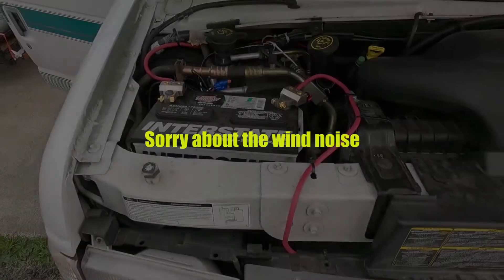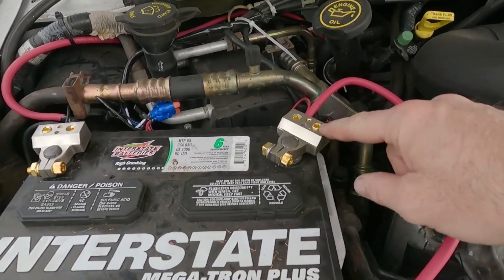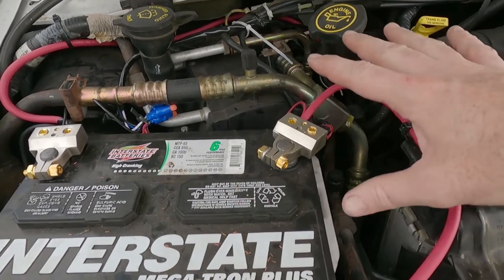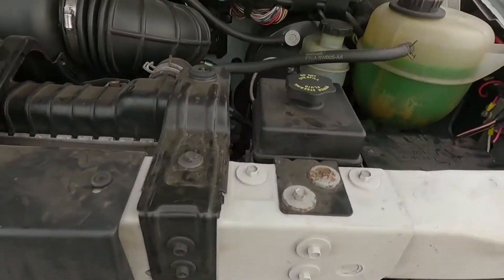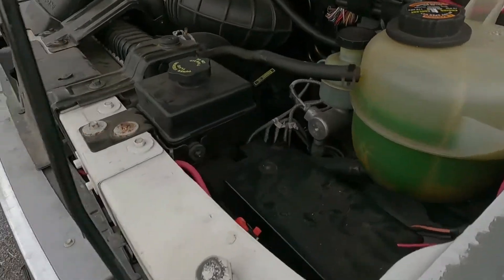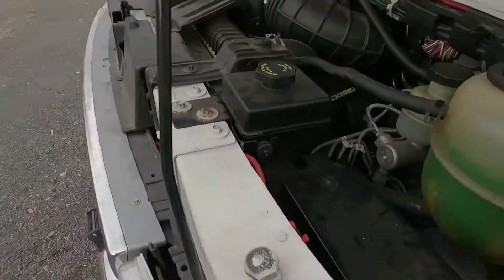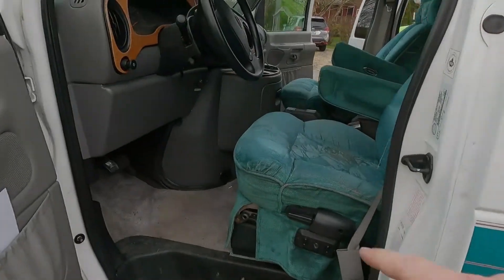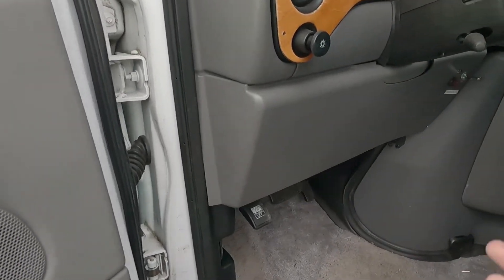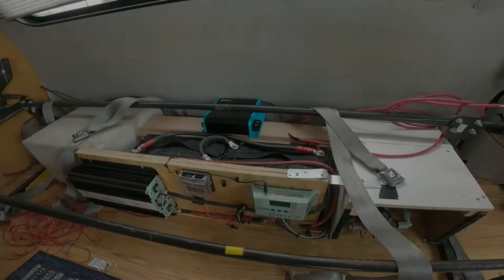Here you can see the two different cables - I changed out the battery cable ends, and these are great with four set screws, making adding connections really simple. Off the positive line I ran it all the way up behind the grille to give easy access to the 30-amp breaker, which I mounted on this side of the vehicle. I've got an inline 30-amp fuse there, and then it runs back underneath and into the van, running underneath the dash and kick plate all the way back to the system under the bench.